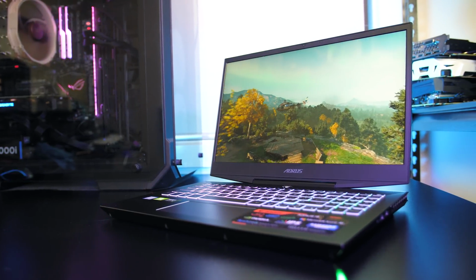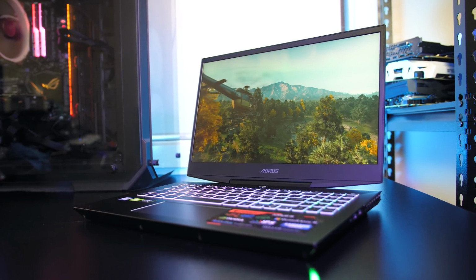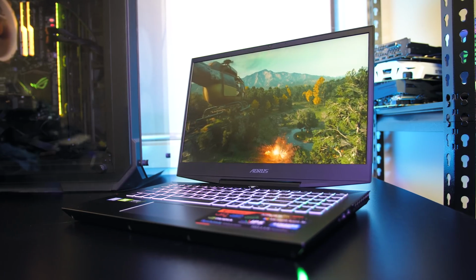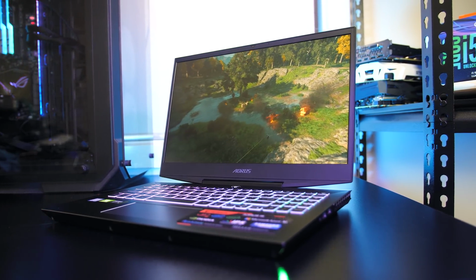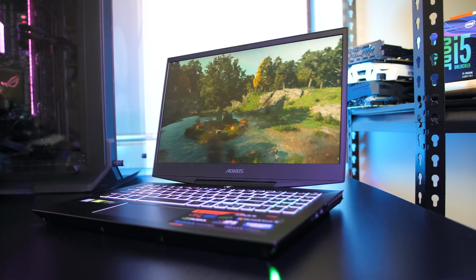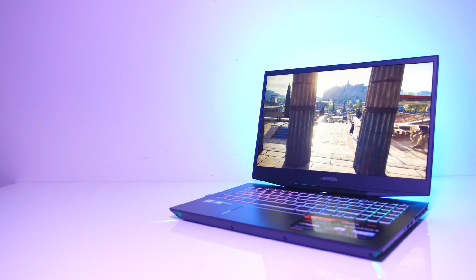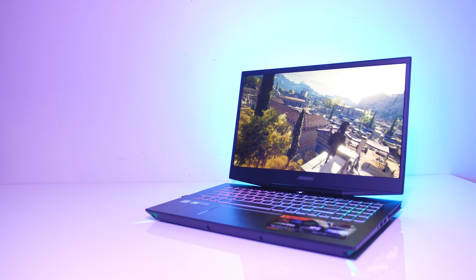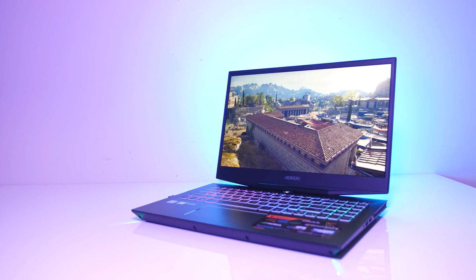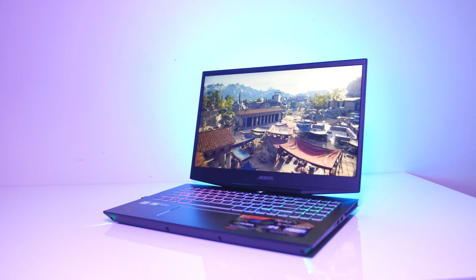The i7-8750H CPU, RTX 2060 graphics, and dual-channel memory are giving us impressive results in most of the games tested, even at max settings. The Aorus 15 is also available with RTX 2070 graphics as well, so expect even better performance there. As noted throughout the games tested, the 1% low results of some more CPU-demanding games seemed a bit lower than I expected due to current limit throttling. Despite this, overall performance was good, and while playing games, I can't say I noticed any issues.